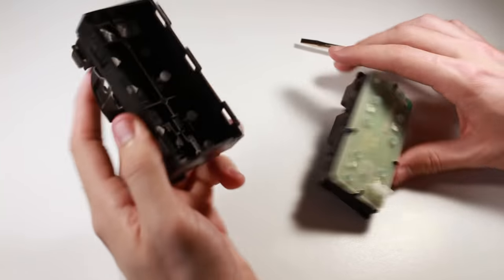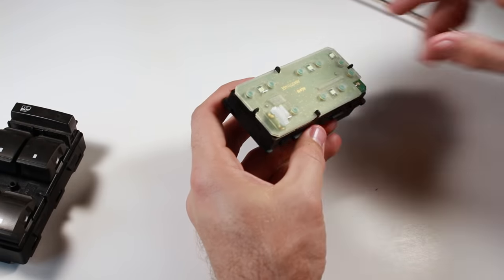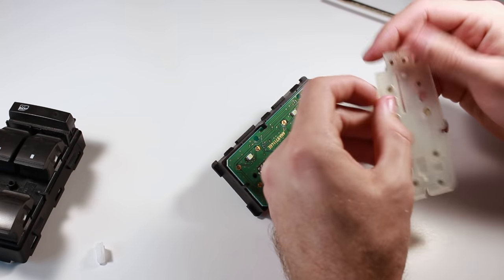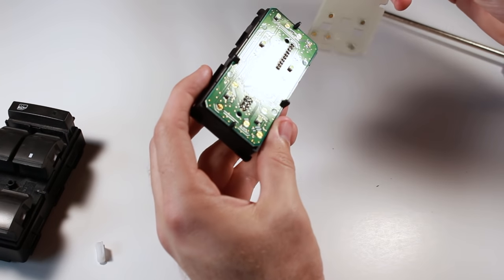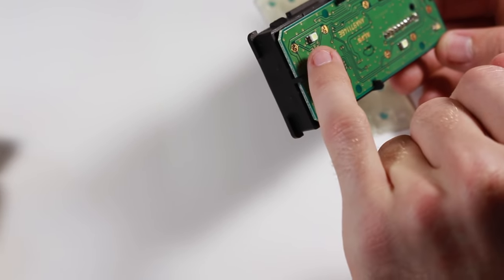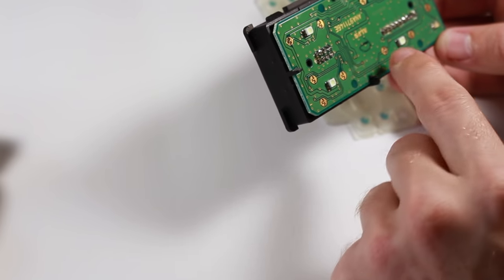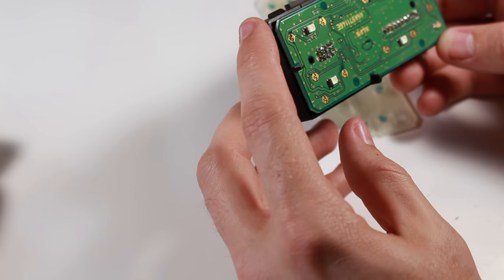It just came out. What you have here is just a switch panel — just plastic, they sound really cheap to be honest. Right here is just for your driver's side, like a switch connector. Here's the plastic cover — I'm not too sure the name of it — but it has connectors, which are these goldish looking things, and here's the base for it. This is where all the circuits complete when you press down on the buttons. If you look, this is the passenger side — that one looks a little more darker than the rest. All that's on there is corrosion. The other ones have some corrosion but it's not a big deal. There's pretty heavy corrosion, especially when I try to press the button down for the window to go down.